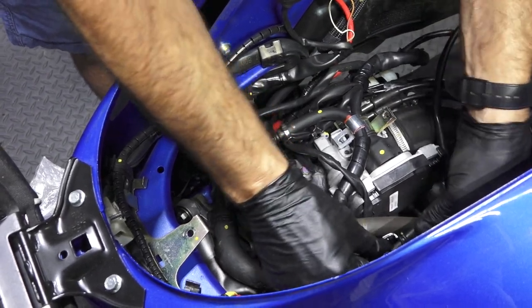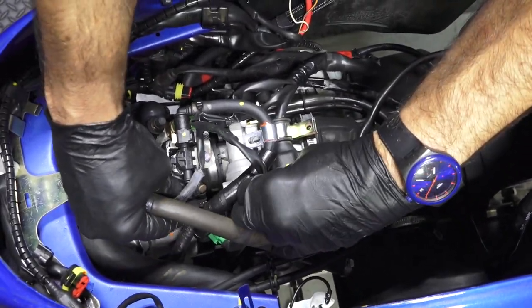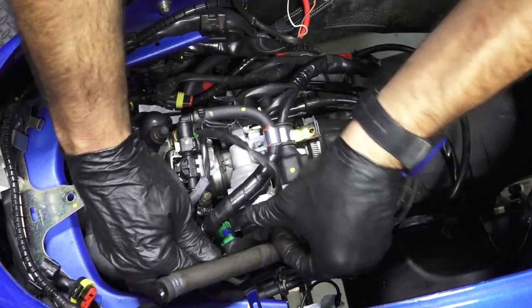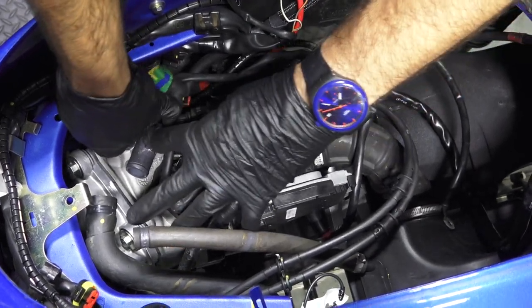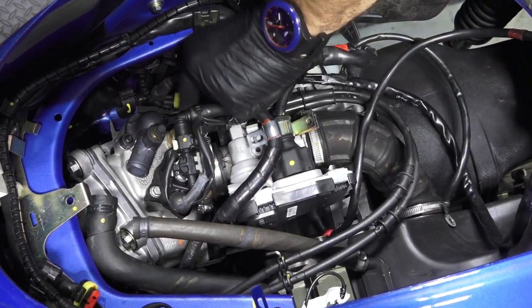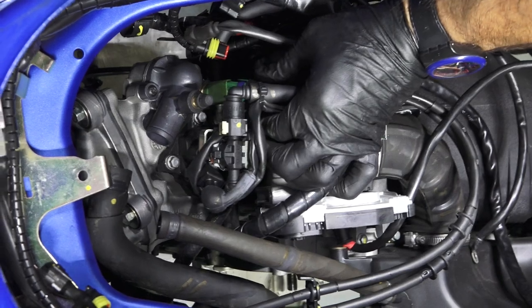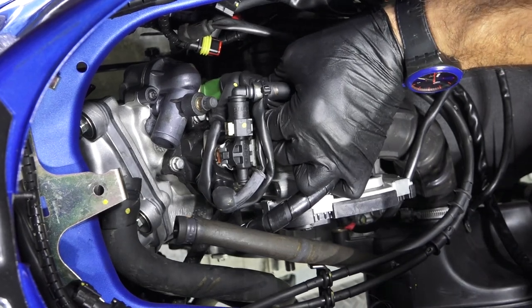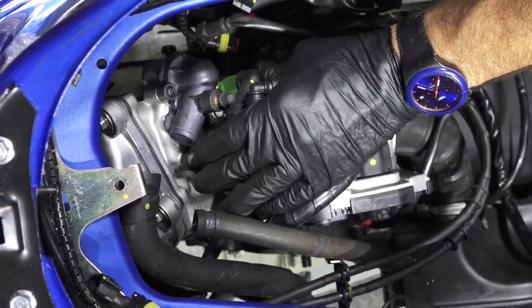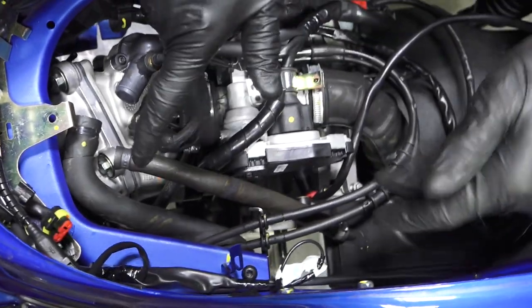This hose, you can see I just pushed a connection for that. This is your connection for the fuel injection. It snaps right on, make sure that's tight, and the clip snaps. This kind of wraps around here, goes past it. Sometimes if you put a new sensor in there, the connector may be in a different position. You can see it will only go in one direction. The shield goes up, and you'll hear a distinct click. That little click indicates it snapped in place. I've seen that connector broken quite a few times from mishandling or whatever.